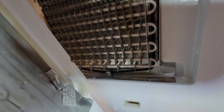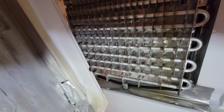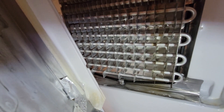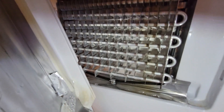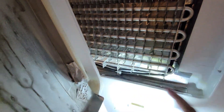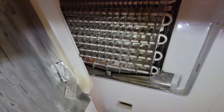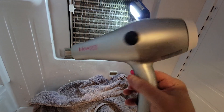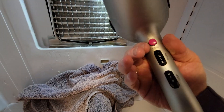Now I'm going to get a hair dryer and blow on that for a while — just maybe unplug the hole, have the refrigerator pulled out. See if I get water to drain down to the trays in the back. If I can, then I know the hole is unplugged. Put everything back together, try the fridge out for a while. If this happens again, go on Amazon and get the three- or four-dollar part. You'll have to end up cutting this off and putting the new one on, because that's a heating element — gets really hot and supposedly keeps that open. Alright, this is going to get kind of noisy. We've got the good old hair dryer — my wife loves this hair dryer — and we're going to use it to its full extent. Full blast, super hot.